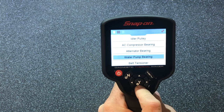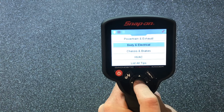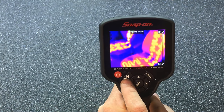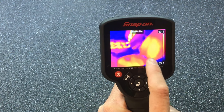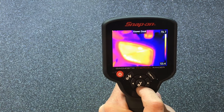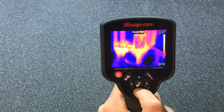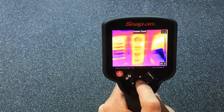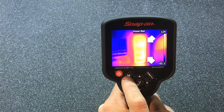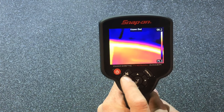A lot of people are going to use it for body and electrical — like heated seats. You can see all the heating elements in a known good, and on the known bad you see nothing, so you know you have a heated seat problem. It also covers heated mirrors, window motors — that's pretty cool — and even the four-wheel drive switch, where a known bad shows it shorting out and getting hot. You can also check window seals by turning on the heat in the car.